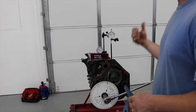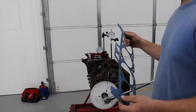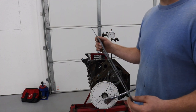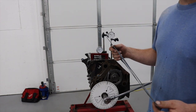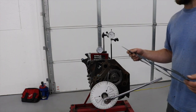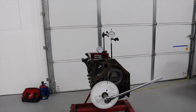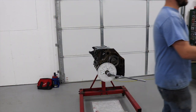These are the pistons that came with this motor - it's just a stock bottom-end engine, so I know radial clearance won't be an issue. But actual piston-valve clearance could be a problem. I would like to run a little more on the exhaust side - typically 100 thousandths is acceptable on the exhaust and 80 thousandths on the intake. My only concern is heat on the exhaust valve. So I'm going to put the head on and we'll check piston-valve clearance.